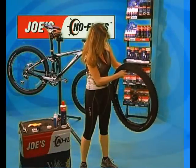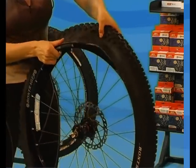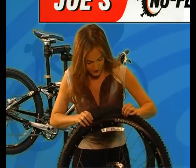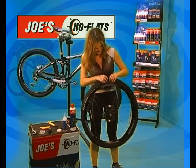Set the wheel inside the tire first, so each side of the tire is mounted from each side. Mount one side of the tire and check that the tire is seated inside the rubber rim strip and not pinching or folding part of the rim strip under the tire. Now mount the second side of the tire.